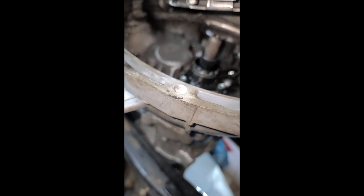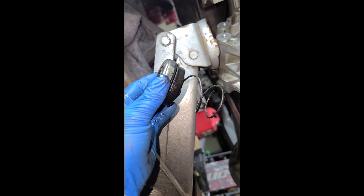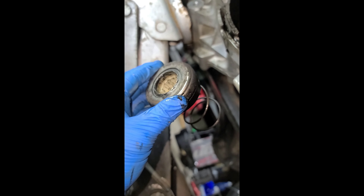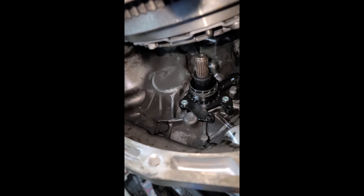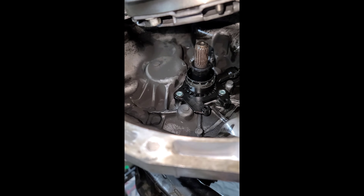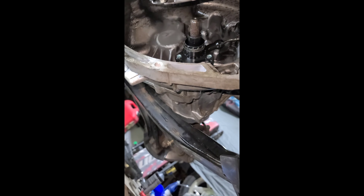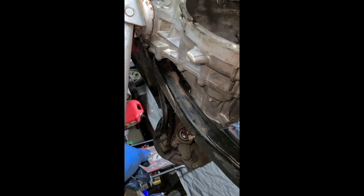There's your slave cylinder — it just came off mine. That's your throwout bearing right there. See those little shiny metal things, those little holes — that's where the bolts are, there's another one up there. They are 3/16ths allen — might be metric, I don't know, but that one fit. Now I've got to take that out of there and I'll show you how to get it out too.